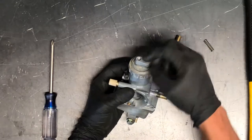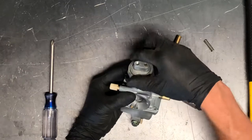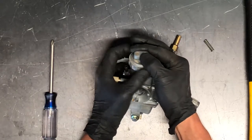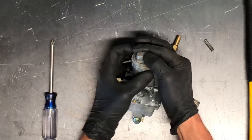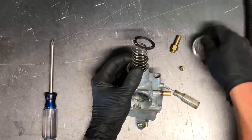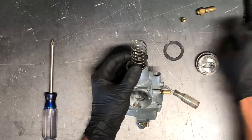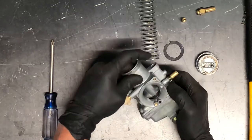We've got your top cap here where your throttle cable comes down into — it's a threaded area there. Obviously if we've pulled the throttle cable we've already had this off. This is two separate pieces here and it's spring loaded, so just keep some pressure on it so that when you pull it loose the pieces don't go everywhere. There's an O-ring seal that will be in that spring area as well — you want to make sure that it is in good condition before going back together.